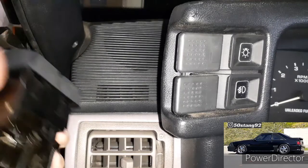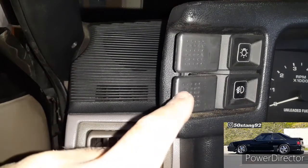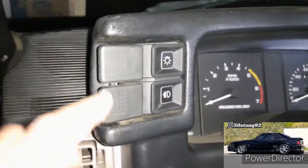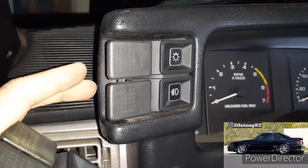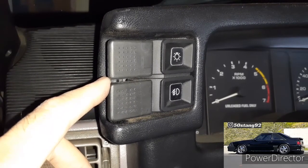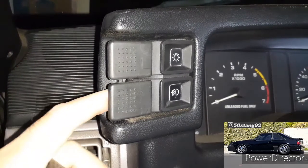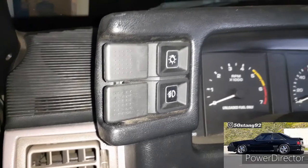With this new one I made sure it had the fog light symbol and confirmed online that it's made for a GT. The new one is installed and the clip inside doesn't have any dark spots from burning. If you notice any kind of plastic smell, check your light switch inside — take your lights off and check it. Your lights won't be working well and you'll notice flickering, and you don't want any kind of fire in your car. That's how you install this light switch.